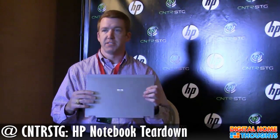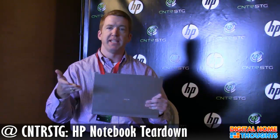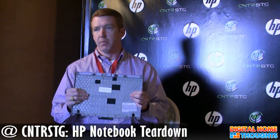Here's the display enclosure for an 08 EliteBook. You can tell just at first glance from the outside it looks very different. We've gone with the anodized aluminum on the outside, and then on the inside you can see the honeycomb structure — that's magnesium. We've done that because we wanted to get the increased rigidity. I'm putting about the same force as I was on the last one, and you can see it's bending much less. As far as the force to deflect pushing in, it takes about 50% more force to deflect it, and about 80% more force to twist. It gives you a much more rigid display enclosure, which translates into a better user experience and a more reliable, more durable notebook.